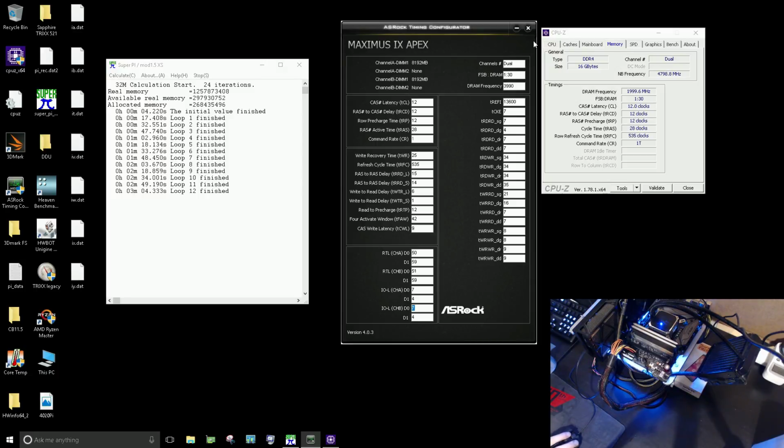So, yeah. That's that. And the cool thing is, if you're ever overclocking memory on Ryzen, you don't have to worry about all this other stuff because you only have access to the first 4 timings, and so you can't actually do 4000 because there's no way the board is going to load up the very specific settings that you need. But also Ryzen currently can't go over like 3700, or well, 3800 I think is the absolute maximum somebody got at decent memory timings. So yeah, and actually SuperPi is past halfway.